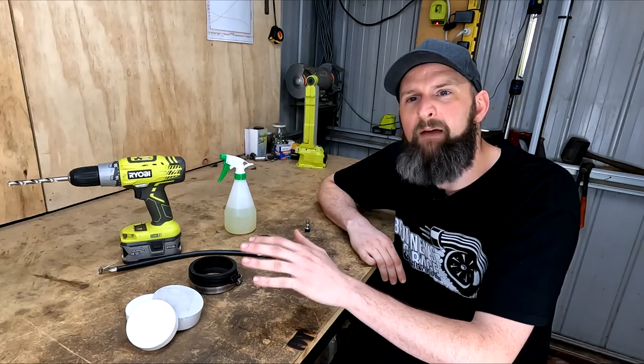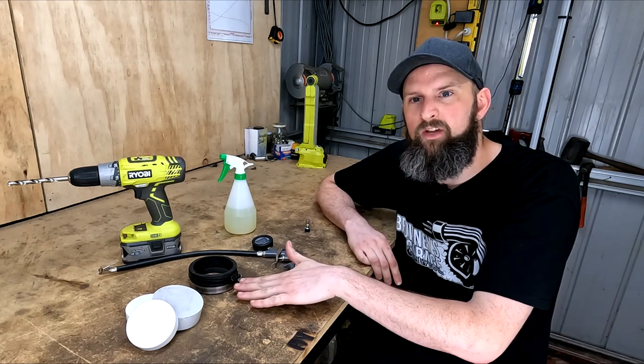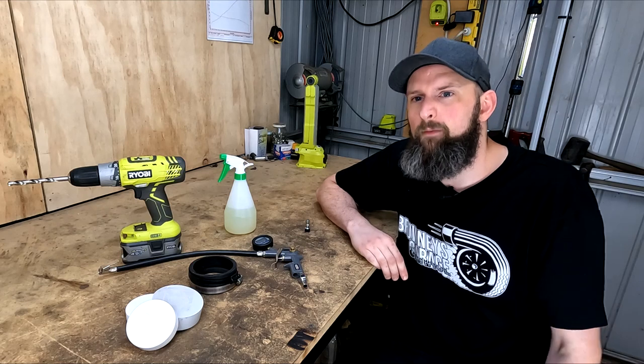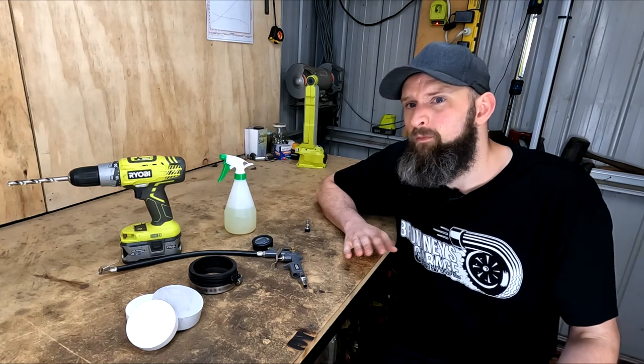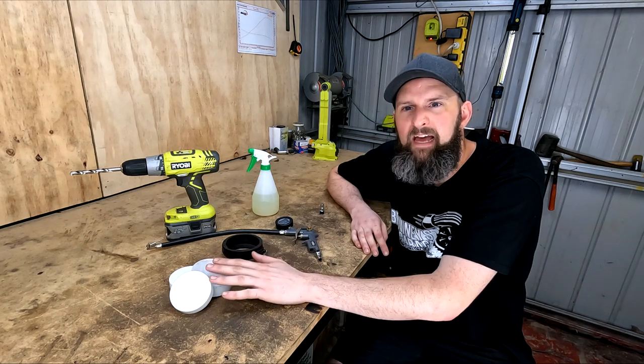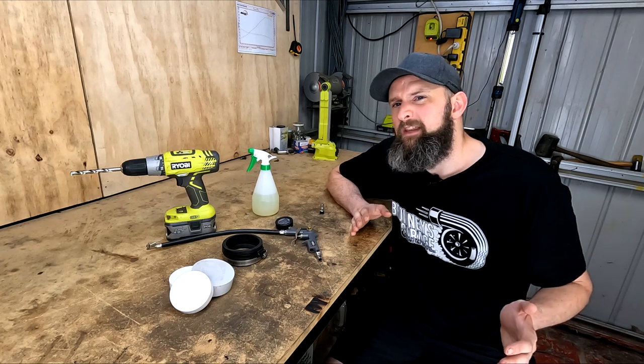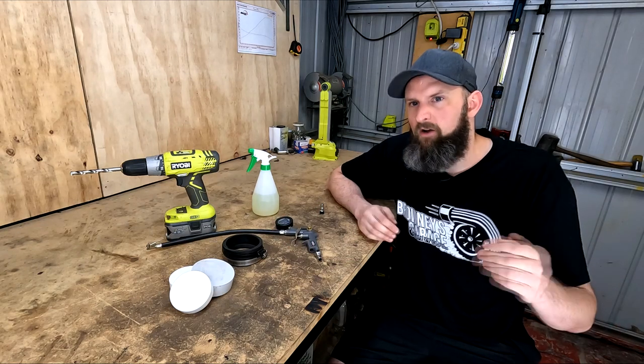There's a PVC cap from Bunnings or any hardware store with a joiner and two hose clamps, sized to suit your turbo compressor inlet, or reuse the ones off the car. I'll be using a 75mm cap and 3-inch or 76mm joiner. Should be the same for all stock size Barra turbos.